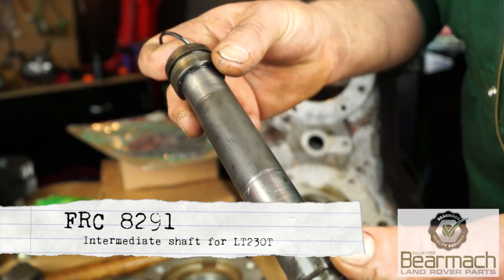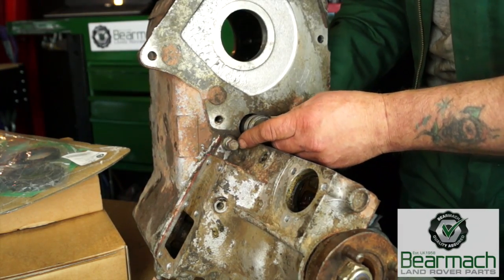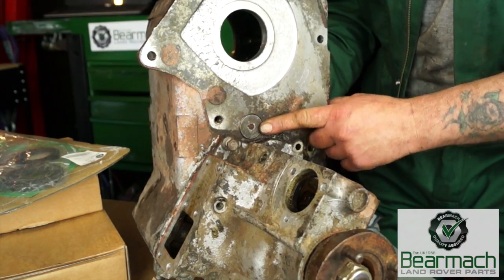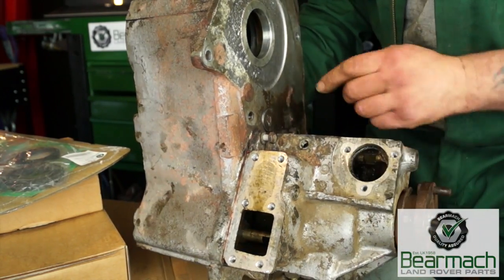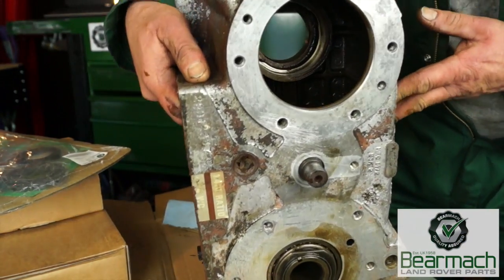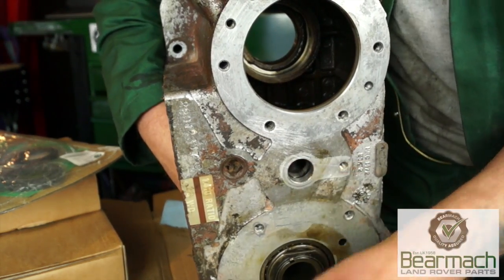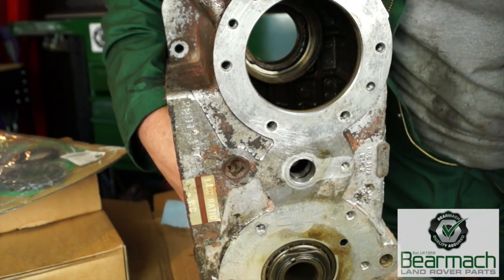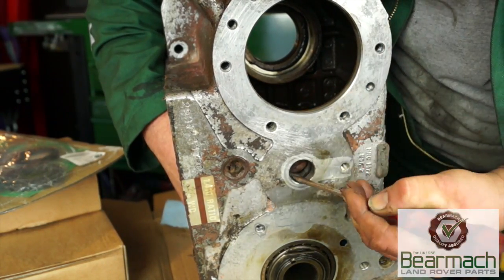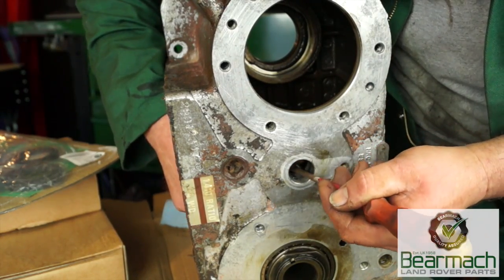This one is going to be changed but for the use of this tutorial we're actually going to use it. The other thing you need to check — and this is vital — is this pin recess here in the casing. If it's worn at all then the casing is unserviceable. There's nothing you can do about it. There's an O-ring in here as well which needs to be changed, which will be in the gasket set. You can pull this out with a screwdriver — make sure that you don't damage any of the edges where the recess is.